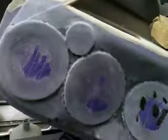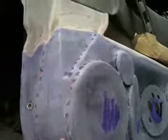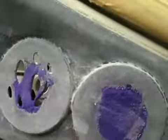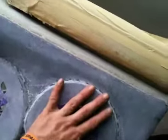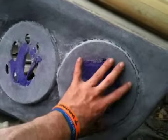First thing, my first approach is I hit this with a 36 grit grinding disc with the grinder. This guy right here. Alright. And what you're doing, you don't want to tilt it, you don't want to put gouges in it. If you notice, you look at it, there's no gouges, there's no signs that it was ground aggressively. My technique is to actually level. My bodywork begins here because I want to apply as little Bondo as possible for the finished product.